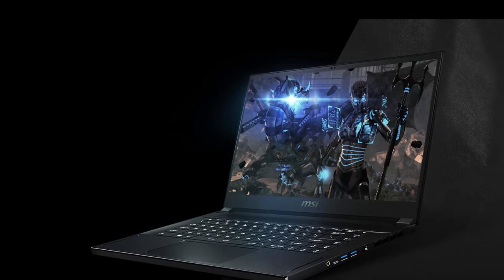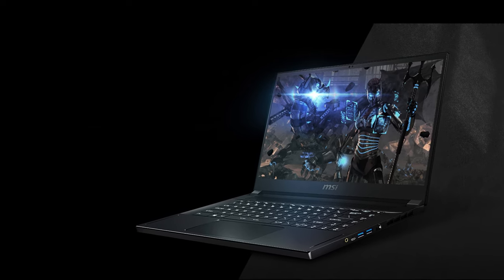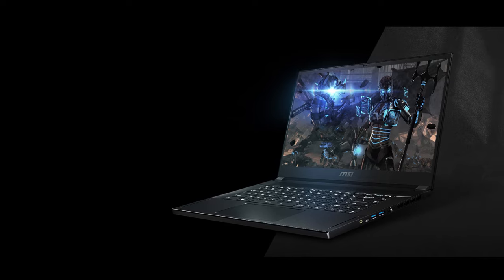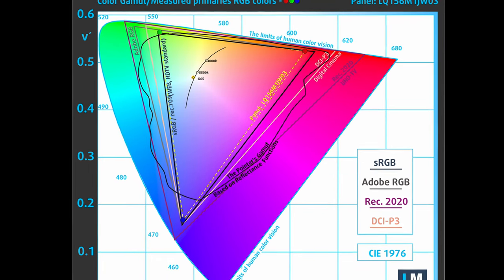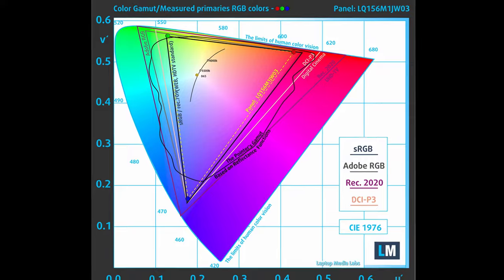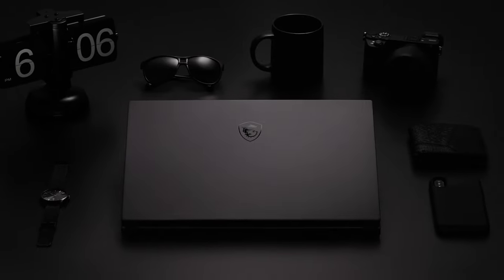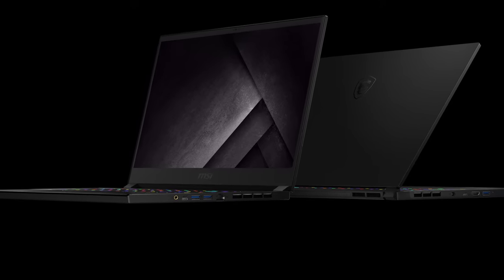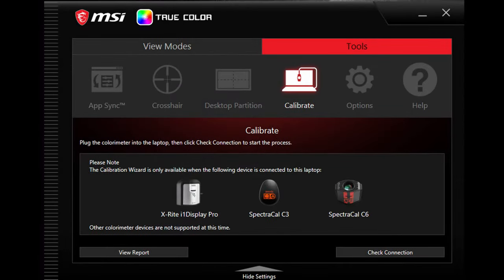One of the best features of this device is the display. MSI GS66 Stealth's IPS panel, Sharp LQ156M1JW03, has a full HD resolution, comfortable viewing angles, and a good contrast ratio. Moreover, it sports a wide color coverage with 95% of the sRGB gamut, and its backlight doesn't flicker at luminance levels above 71 nits. Below that, the frequency is very high, which is good. Using the sRGB preset not only provides you wide color coverage, but also accurate color representation. Combined with the 240Hz refresh rate and quick pixel response times, this device is great for gaming, professional work, and retail purposes. Not many displays feature calibration software embedded into their gamer-centric apps. And we really appreciate it.